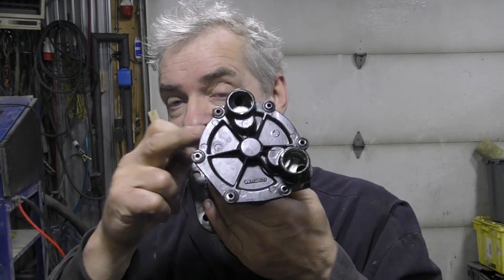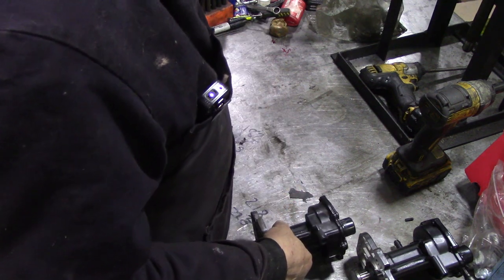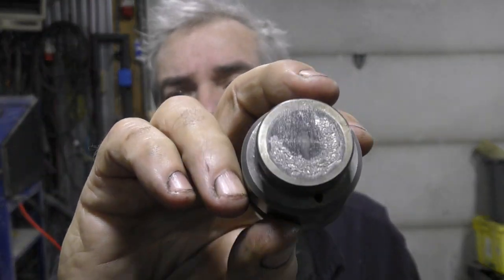I'm going to take the pump off the engine this afternoon and see if the gasket off this one will fit and seal — who knows. Whilst it's on the engine I can pressure test it and make sure it's not going to leak. One of the things wrong with the original pump — this one here — you can see I've made a blanking plate for it. I've got it taken off. The faces here — it's gone through its hardness and I had to change the cam as well.